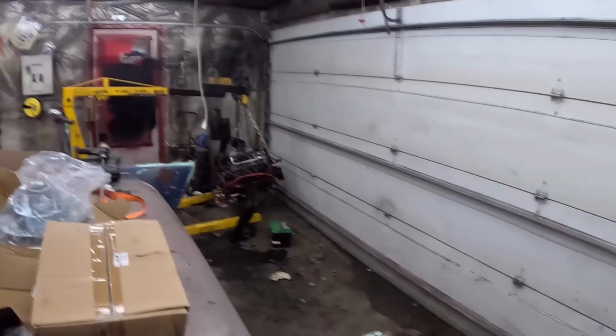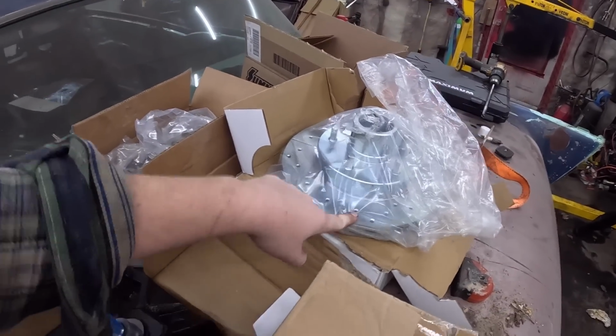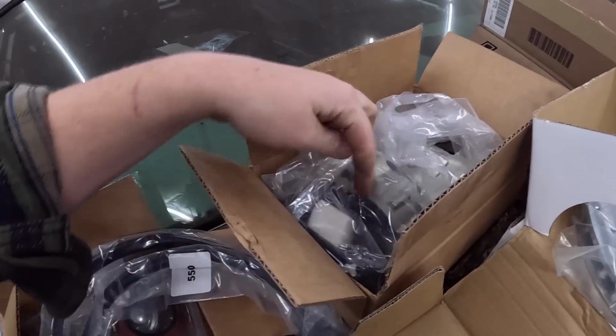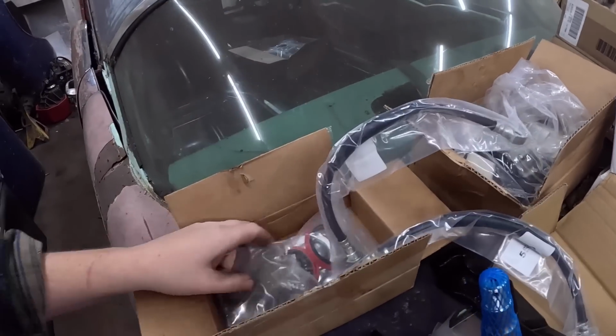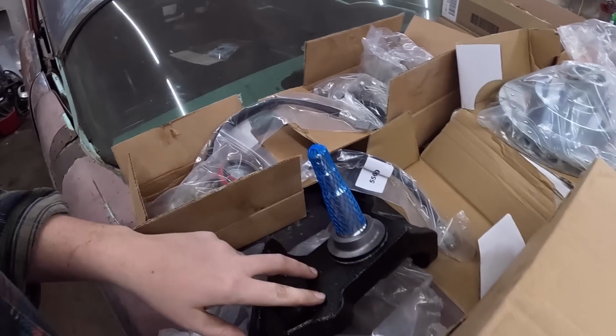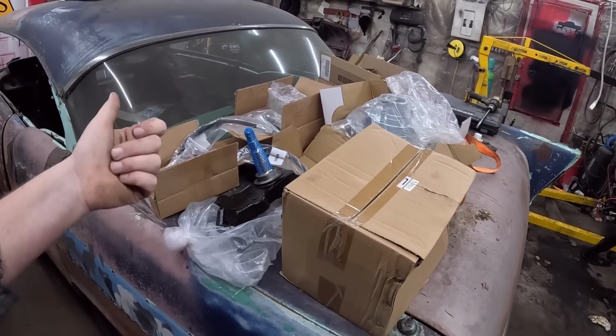And control arms. We got disc brakes, and they're drilled for whatever reason. I went and got drop spindles. It's got your standard GM single piston caliper deals. Rubber lines, bearings, dust caps, and that's it. So you do have to supply master cylinder, brake booster if you want. We're just going to run, I think I got one, just a regular master disc drum deal, and we'll have to plumb it ourselves, but that's down the road a little. We got to get this thing all together.